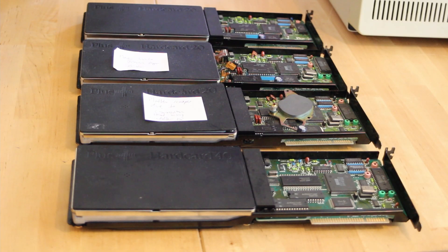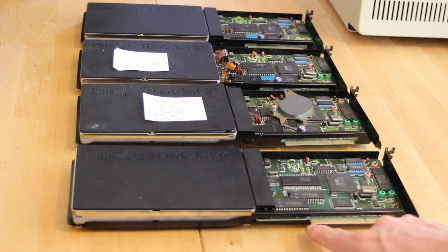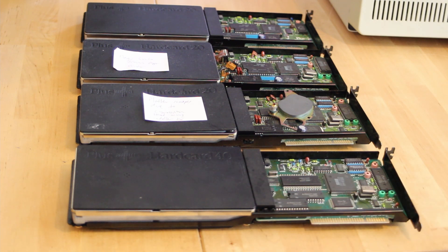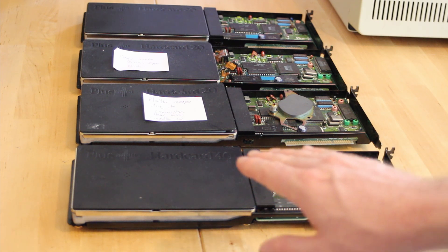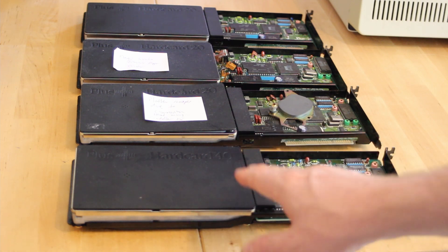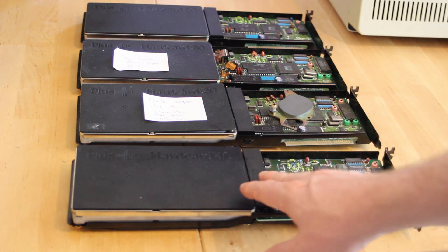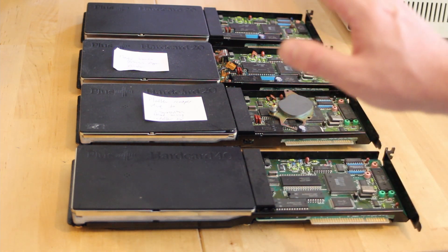Now let's get back to these hard cards. These are a hard drive attached to an 8-bit controller. There were some later ones that had 16-bit connectors, but these are for an 8-bit slot — so they'll go into an original IBM PC, or an early XT, or clone. They don't even need to have any support in the BIOS for hard drives — everything's on this board. And they're also a very low-power device. I think these might even work in an original IBM PC, which only had a 63-watt supply. You definitely don't want to be putting a big old hard drive in those or you just blow the supply up, and that's one of the reasons why the XT came out. My PC actually has an XT power supply in it, which is almost twice the wattage, so there's no problem putting one of these in.